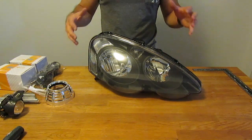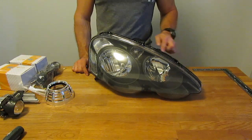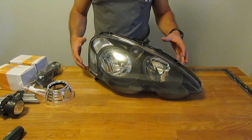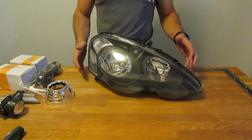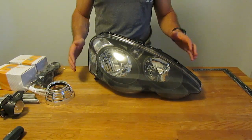In this next step you will be opening your headlight housings. If you're lucky, your headlight housing is held together with some sort of adhesive glue that you can peel apart. Before you peel it apart you're going to have to heat it up. What most people do is put the whole headlight housing in the oven at about 220 degrees Fahrenheit for about five minutes.